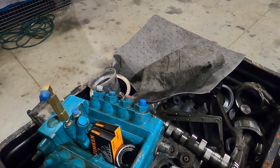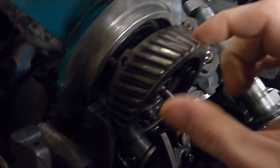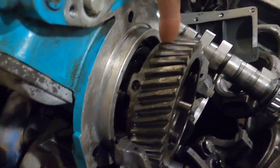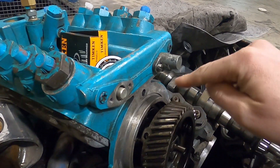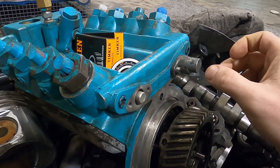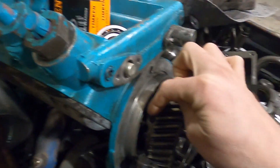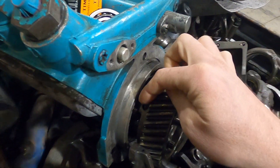What we're doing - this is a different injection pump, just to show you. This hole is the top. When you're on number one firing, it will be facing up on the pump. There's a little cover on top of the tower you pull off, and then you can tell by the indicator where the number one cylinder is.